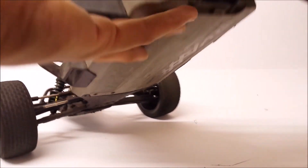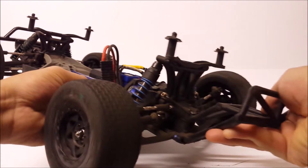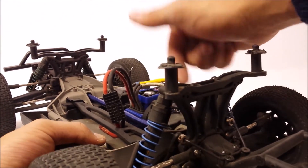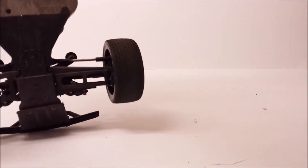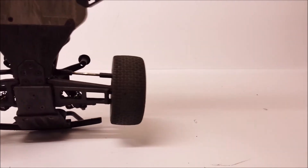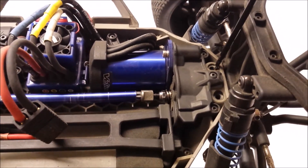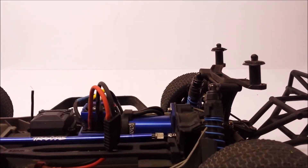After you've done that, bring up the rear clip and slide it in just like so. My technique is to stand the car up, hold one wheel, spin the other, and then the diff will rotate and it should key in pretty easily. After you've done that, go ahead and install the two screws from the top and the two screws from the bottom.